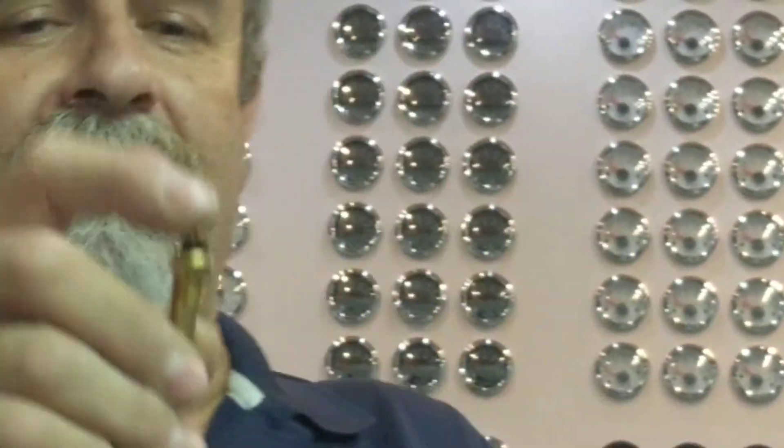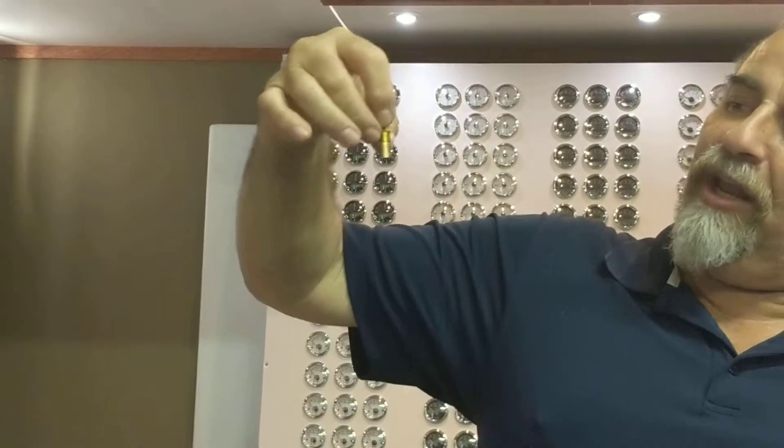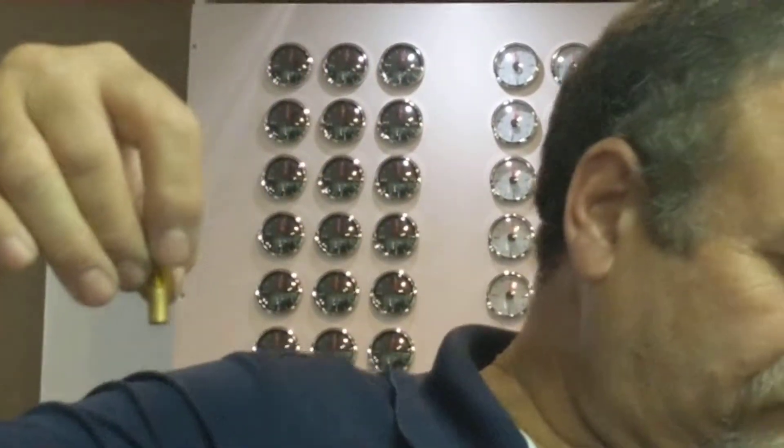You can then add a small temperature sending unit — it's only 1/8-inch NPT, very small, and will only go about half an inch into the cover. The NPT tap is available at any hardware store for about five dollars. That will do the job, and you can connect it to the actual temperature gauge.